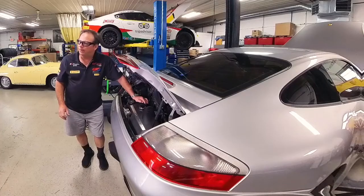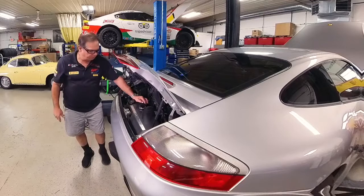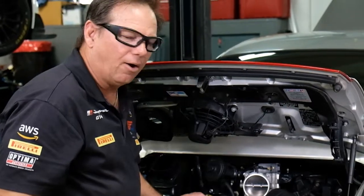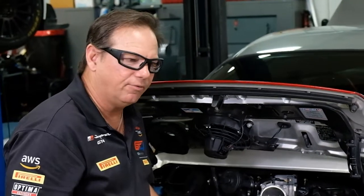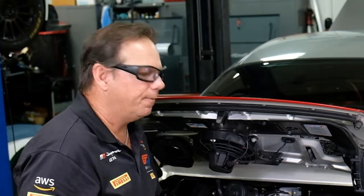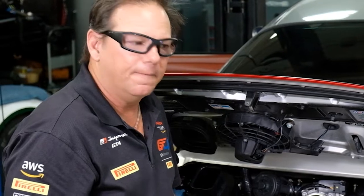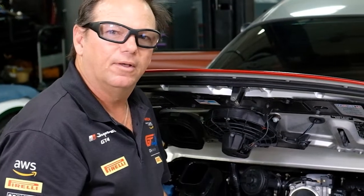One thing I want to emphasize is the plastics on these engines. You have to realize the plastics are in service 24 hours a day. You may say, 'I only have 10,000 or 20,000 miles on my Porsche — how can anything be bad?' But most of these things are touching oil or oily air and they're in service all the time. Like the coolant water pump — the plastic on the coolant impeller is touching coolant 24/7. So it isn't all about the mileage on your car; it's how many years the car has been sitting or in service.